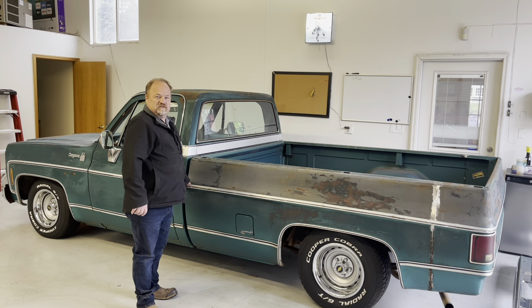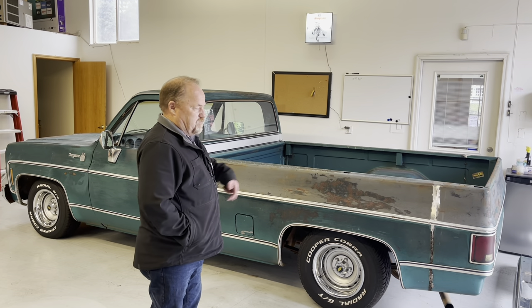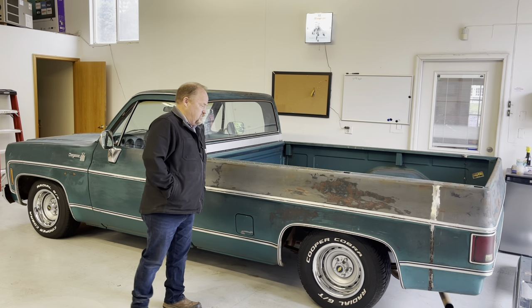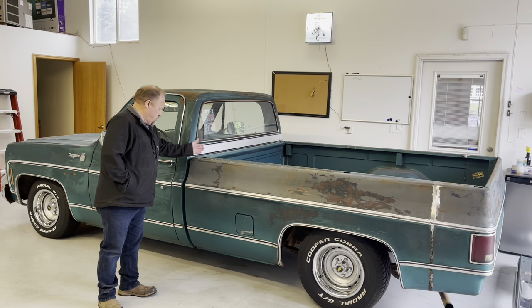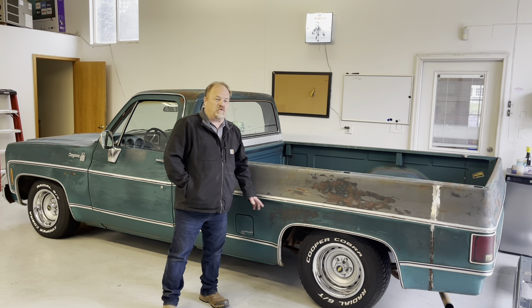We'll simply cut six inches off the end of the molding here, remove six inches, and re-apply it — basically just showing you what it's going to look like. They'll be coming back off; it just takes a few minutes. I'll be taking 14 inches out of them here too. This truck has twin fuel tanks — I think they're 20 gallon. I'll be replacing those with a single tank, probably this left side tank, probably 16 gallon, which is what the short beds are. We'll replace the tank when we shorten the frame.